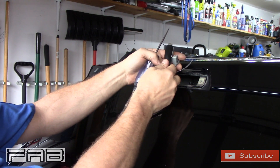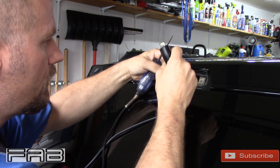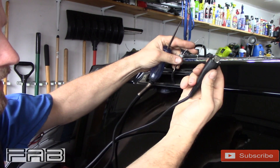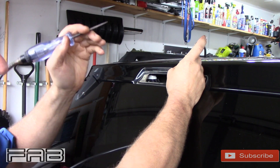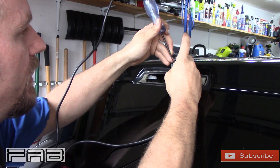It doesn't matter which side you put the paper clip in. You're just gonna put it in and clip it. This connection's not the greatest, so you might have to hold it. You're just gonna clip it on to the paper clip, and what we're gonna do is make this test light stand in for whatever we're testing. If we're testing a blower motor, this light is in place of the blower motor — we're just checking the circuit. Then you're gonna touch the other side.